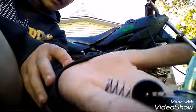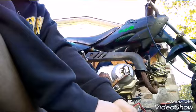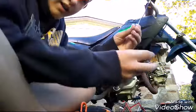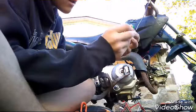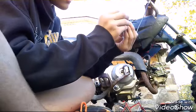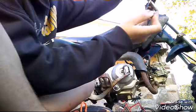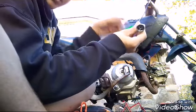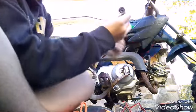Yeah, because that's a little bit bad. So, here's all the old pieces that we had right here. Put them to the side. Grab the new one. This is all you need for the new one. You have to feed the line right through it, put it inside the middle. Now you should see when you twist it, it goes in and comes back out. Whenever you twist it, that's what the throttle is.